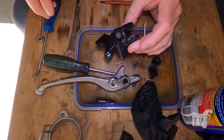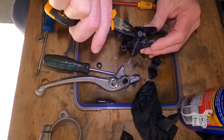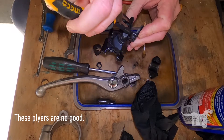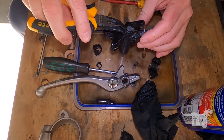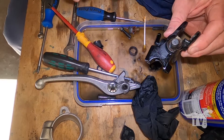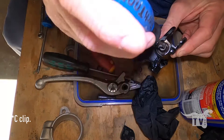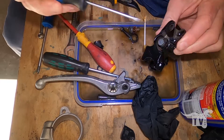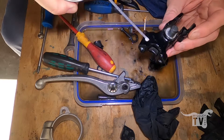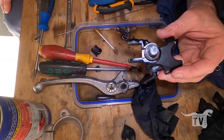Back in the garage again. Today we're going to remove the piston and pull this little dust seal out - it's perished anyway. I just need to remove the circlip. After a bit of digging around with a little screwdriver we managed to get the dust seal out - the bottom part of that rubber dust seal. Now I just need to take out the circlip. It looks a little bit rusted, so I'll let some penetrant in there a little bit.